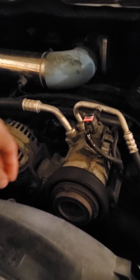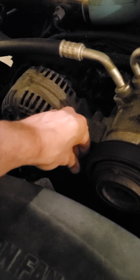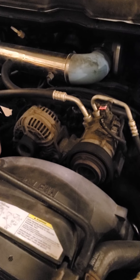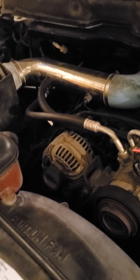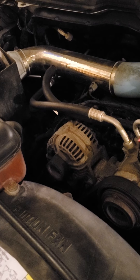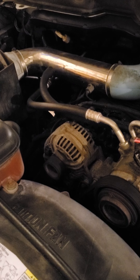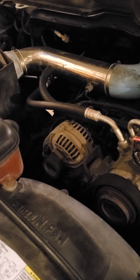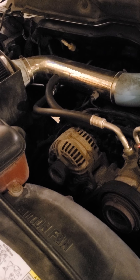Even now when I try to turn and rotate this belt I can't move it nearly as much as before — I thought it was snug earlier but now it's even tighter. The tensioner apparently did the trick; that was my issue. So if you've got a squeaky belt and you've diagnosed that you need to replace the tensioner, this is how you do it. Hope that helped — hit that like button and subscribe. I've got a couple more videos coming up on the Dodge: going to do some brakes and try to get that pesky check engine light off.